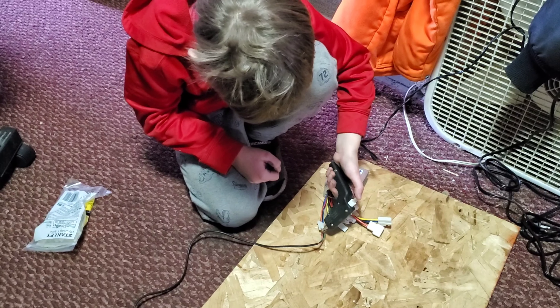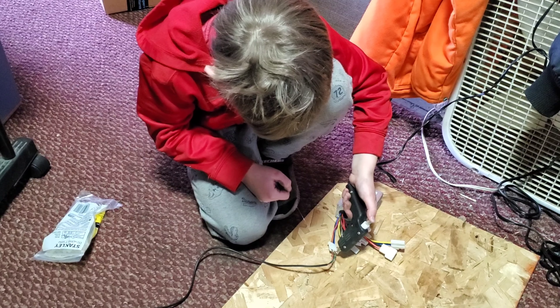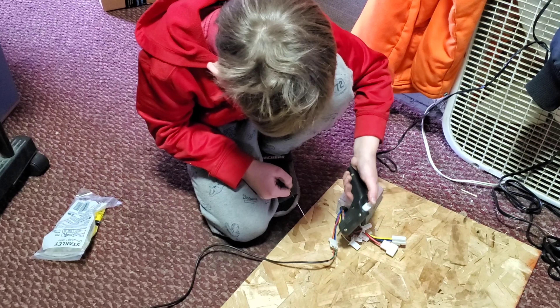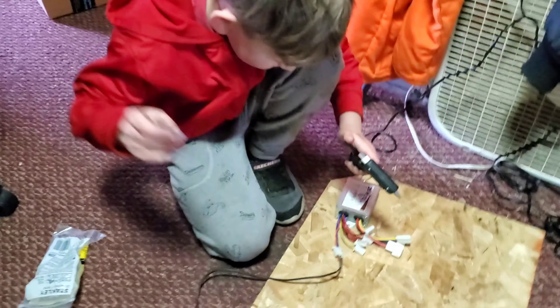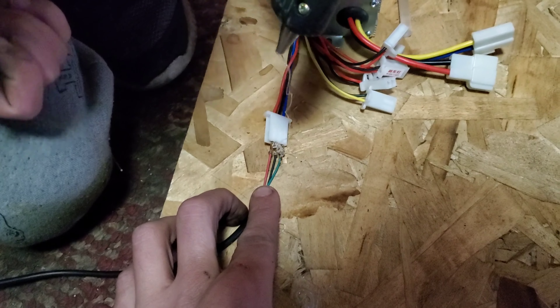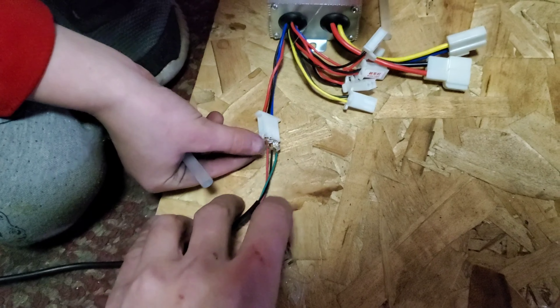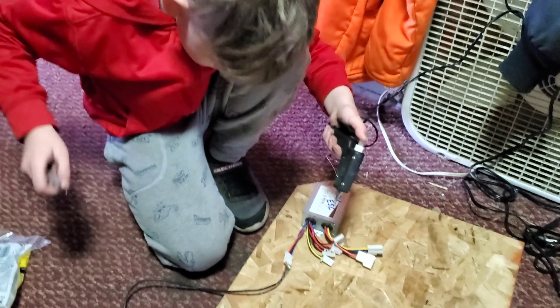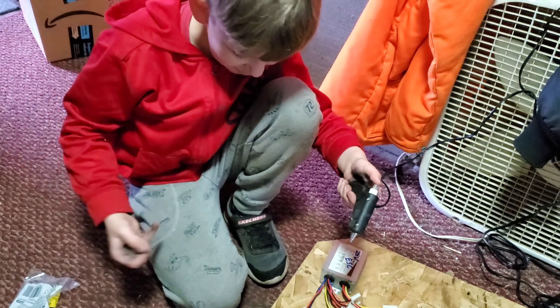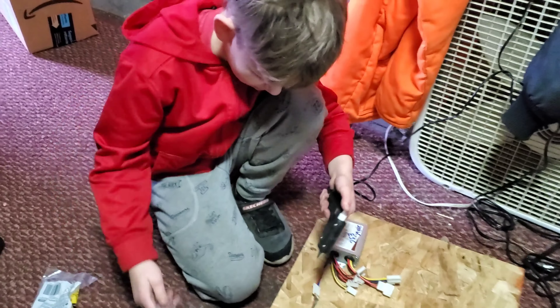Can you explain what you're doing? I'm right now trying to hot glue the wires to make a plug. So what John's doing here is we pulled out the center core of this and plugged it in, and now he's filling it with hot glue on both sides so that the terminals can't short together. Because if the terminal shorts to ground, it goes to full throttle by default. So we don't want that to happen.